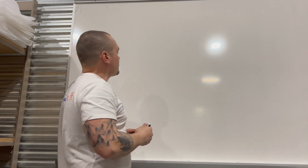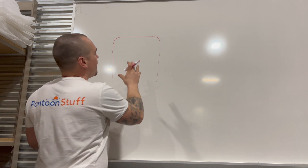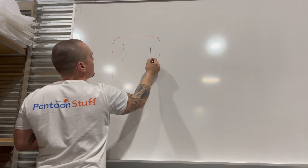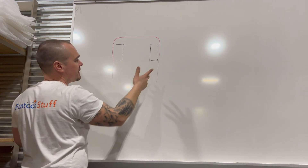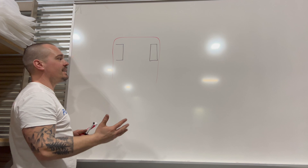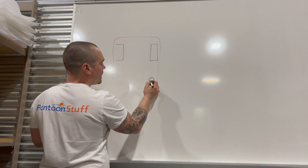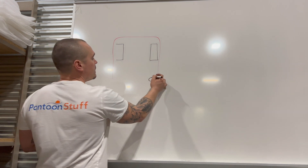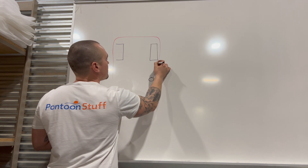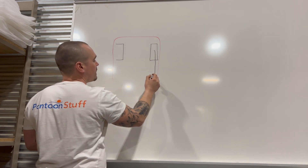Hopefully this makes some sense — you just need a positive from the battery or a switch to your accessory, as well as a ground, and then from there we can share all of those accessories. I just wrapped up recently some under-seat LEDs in a boat. My switch panel or helm is here. I ran wire from there — it was a two-strand, a red and a black — so I ran a black ground wire and also a power wire up underneath this seat.